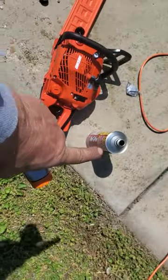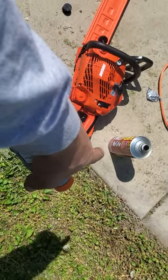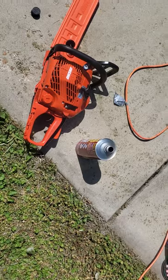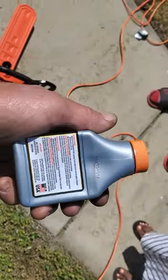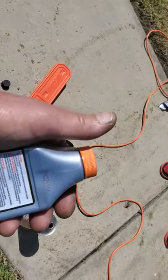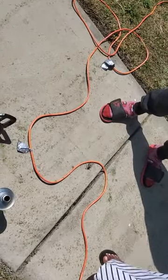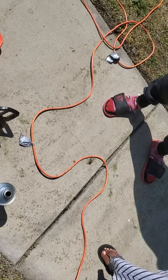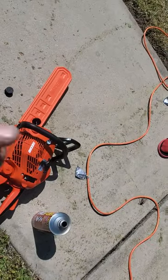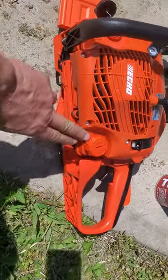After mixing, you can also use True Fuel — that's ready to burn right now, no mixing required. You can keep buying that; it's easy but a little expensive. Or you can mix your own and have a dedicated one-gallon gas can. I took a magic marker and put a '2' on mine for two-cycle, so you don't accidentally use straight gas.